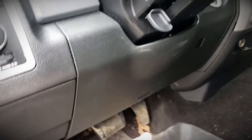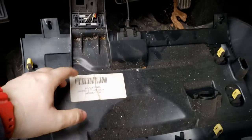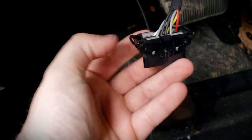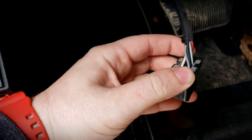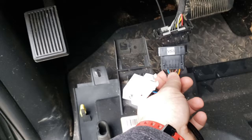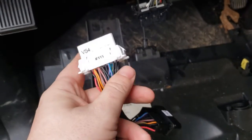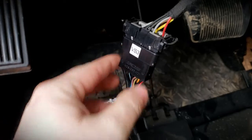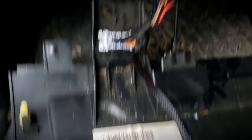There are two bolts down here and it should pop off. After you take off the two Phillips bolts, you'll pull this out and then kind of up and it will release those tabs. What we're going to be concentrating on is the OBD-II port, because we do have to remove it and piggyback our first connection into it. It has two little spring clips — push it in with a screwdriver on one side, finger on the other, and it will pull straight out. The S3 is going to plug into your old OBD-II port; the S4 is going to become your new OBD-II port. You'll just piggyback the S3 into your OBD-II and the S4 back into your holder.